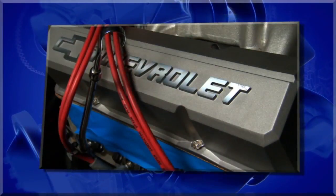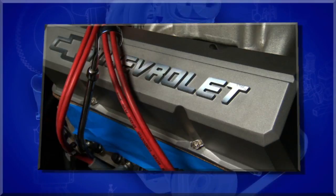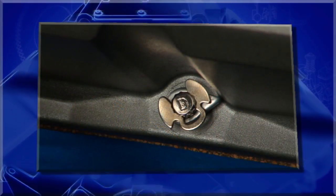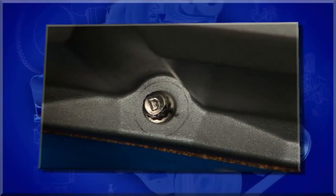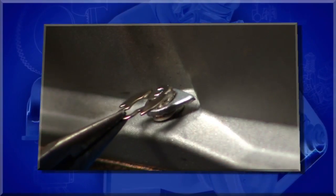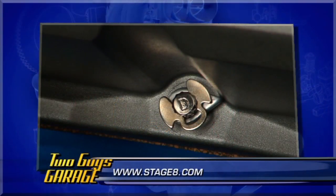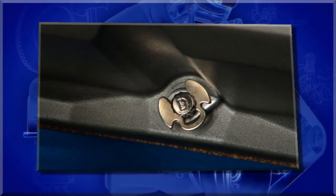Welcome to the break room where we show you all our cool parts. I've got the trickest of trick fasteners — valve cover fasteners from Stage 8 Locking Fasteners. They look nice and function superbly. It's a locking fastener, and a lot of times on a valve cover you don't want to just squash that gasket down, but if you don't get the bolt tight enough it can work itself loose. These have an aluminum locking feature tab — slide it right on, butt it up against the valve cover, then put the little spring steel clip on. That dude ain't going nowhere. They've got rolled threads, they're made in the USA, and come specific to your kit with everything you need. Aircraft quality, grade 8 bolts, duplex nickel plated so they look nice and shiny. Check out Stage 8 Fasteners' website for a lot of cool applications.